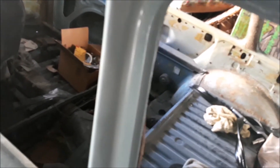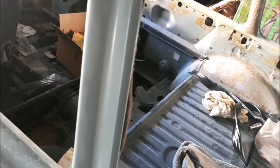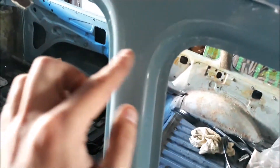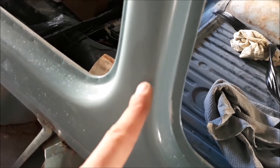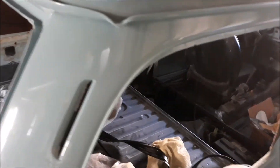So I decided to do everything. The tape was kind of a bad idea — I should have taped further up because I ended up getting a line. All that meant was I took it off and lightly dusted over it to blend it out. This one went a little heavy, so I got a small run there. I've got to wait for this to completely dry, scuff it off, and do that one again. But this other spot is fully done and blended — can't even tell. I have a 24-hour window to apply the clear without having to scuff the paint back up for a chemical bond, but I don't have time today to do everything at once.